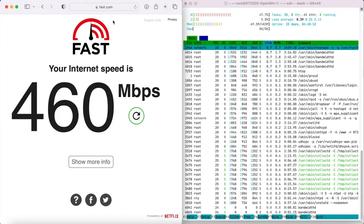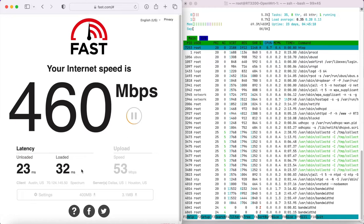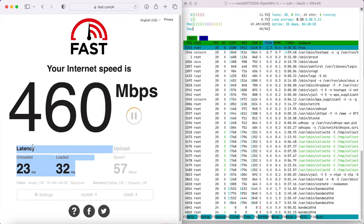While this is quite impressive, you'll be disappointed if you plan to use this with 1 Gbps internet speeds. The only real option to enable SQM over a Gigabit internet line as of 2022 is to run it on a Raspberry Pi or on an x86 computer.